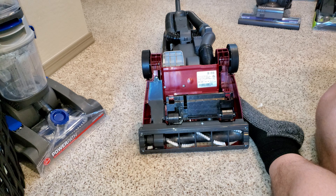I'll take the bin off and then flip your machine over like this. The things you're going to need are a drill, screwdriver, and some replacement belts. Whatever your model number is, search that and you will be able to find what belts your machine takes. This particular machine takes a style 80 from Hoover.